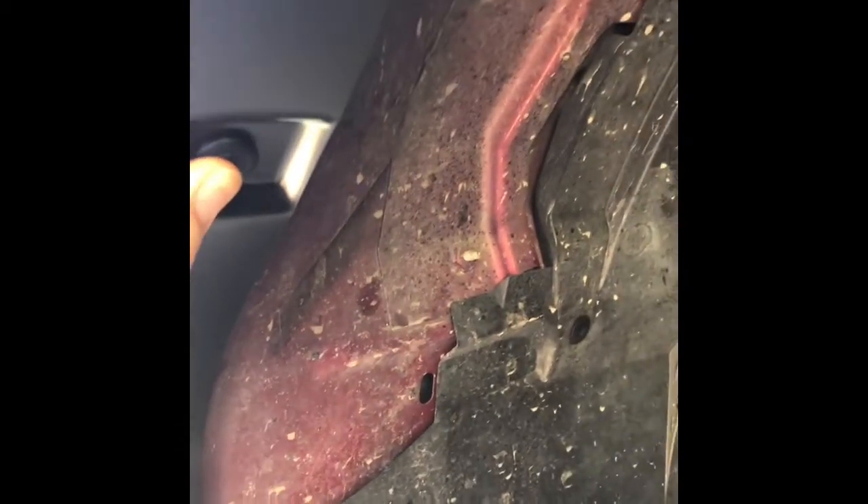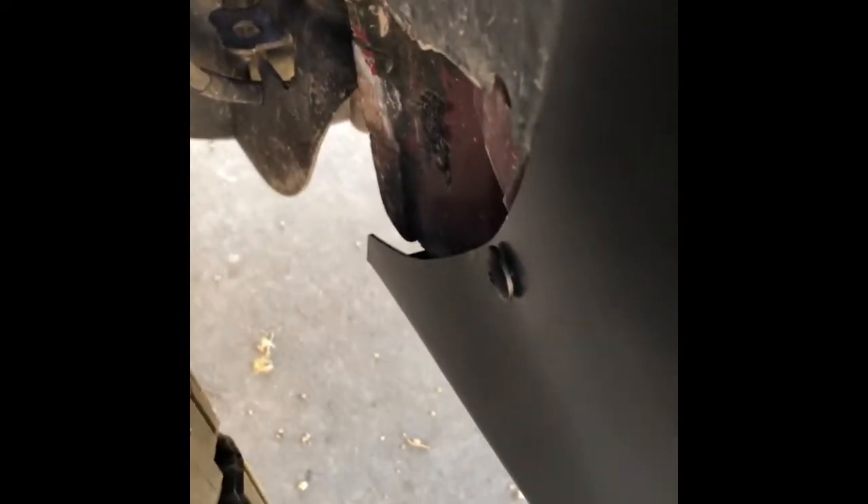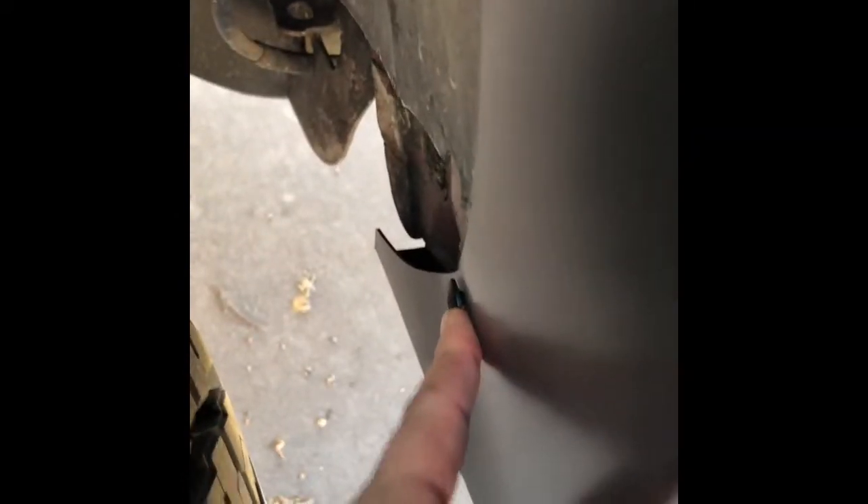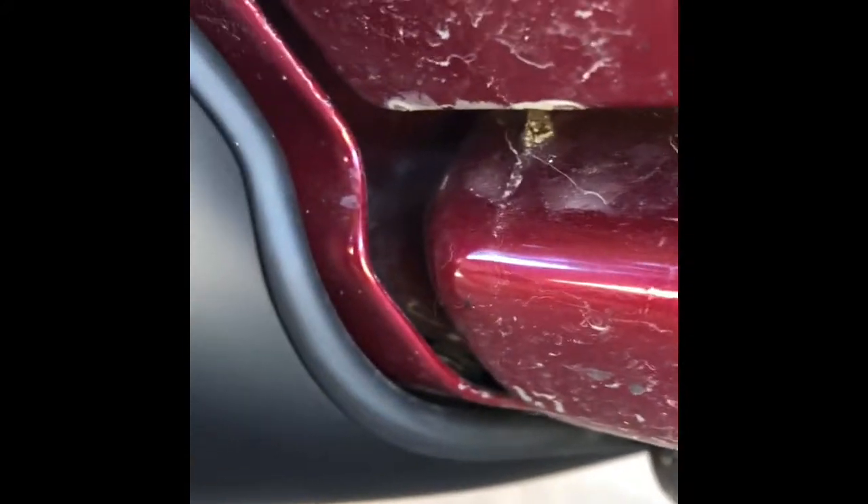The front driver was a little bit of a booger. This one fit nicely up front, but we had to drill the top two again. The back fit, but the problem with the back — as you can see, the previous owner did that NorCal fender mod, cut the lining a little bit. When you beat that panel back, this screw here sits too far from the edge, so it's hard to get that pop-style rivet in. There's a gap right here and it's a little bit loose. What we'll probably do is just put a stainless self-tapper under there just to hold it tight. If you have that fender mod and it doesn't fit just quite right, that's probably why.